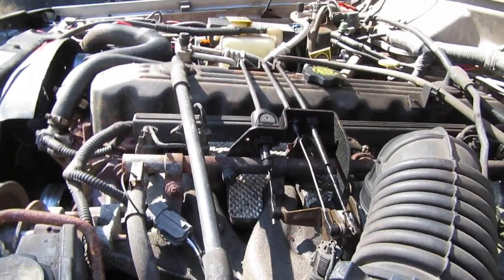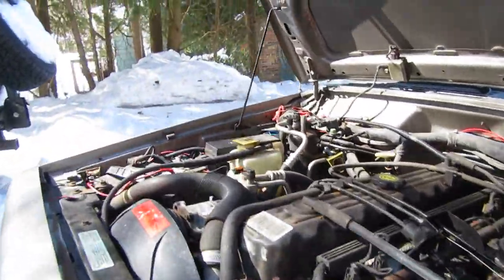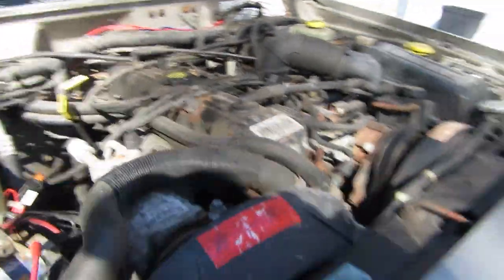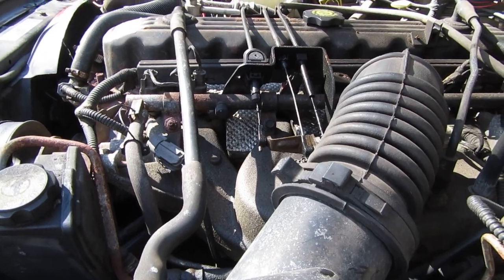The symptoms are sputtering, misfire, low loppy uneven idle. It's pretty apparent and it seems like you threw a rod or something. The first time it happens, it's horrifying. Thankfully, when it happened in this one, I knew what it was because I had it in an XJ I had previously. But the first time I had it, I thought my engine ate itself.